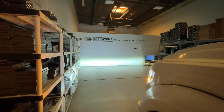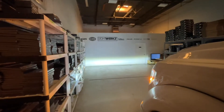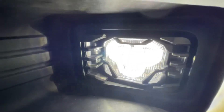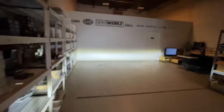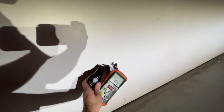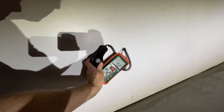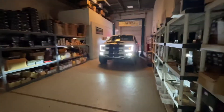Now for the fog lights — turning on the Morimoto Four Banger alone. This is the HXB version you saw earlier in the video, a completely different look with three separate LEDs. Measuring the output, we're hitting about 300–330 lux, which is about three times brighter than the factory Ford LED fog lights.